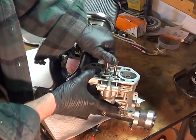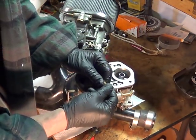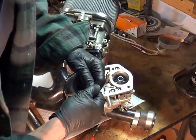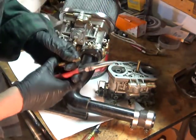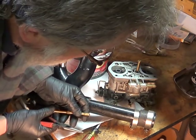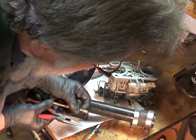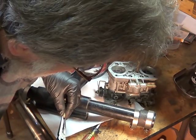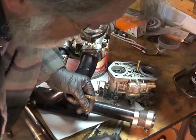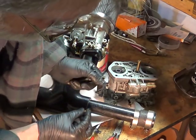These stacks on the top are the main jets — this is for wide-open throttle. The jet is right here on the end and just pushes on. Never grab your jet by the numbers; they're hard enough to see and you don't want to scratch them up. This is a 120 main jet — there are the numbers. These rarely get clogged up, but it's the same procedure: get a light background, blow through it from both sides.